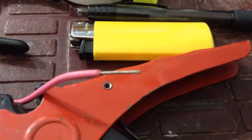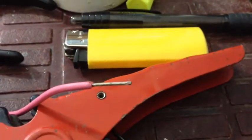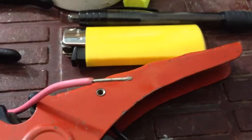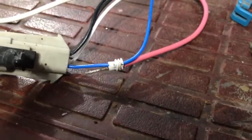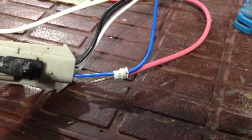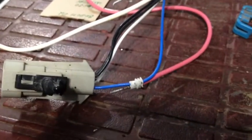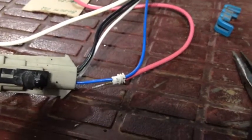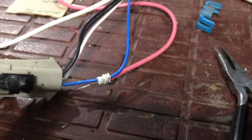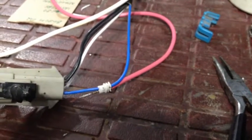It'll become like a pin, and I'm going to push this through the insulation until it makes contact with the back side of the pin that goes to the TSM. In this segment you see the tinned stripped wire passed through the seal that will go into the plug. This is not the plug off the TSM — just one I have laying around to show how it's done. On my Sportster, that's exactly how I've done it: pushed through the back side of the plug, no solder involved, it just makes a good contact.